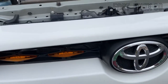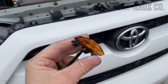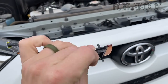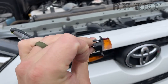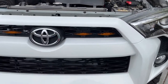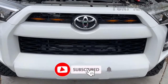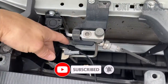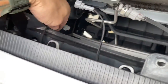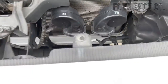There is something you do need to pay attention to though. You can see these little tabs on the top and the bottom — how they sit a little bit further back. On the top, that tab sits a little further back; if you flip it the other way, it's a little more forward. You'll notice right away when you put them in whether they're seated correctly or not. In the back we have all the wires to work with — all the plugs are accessible and we can wire these into the main harness. Then we can secure everything with some zip ties so it doesn't get damaged while driving.